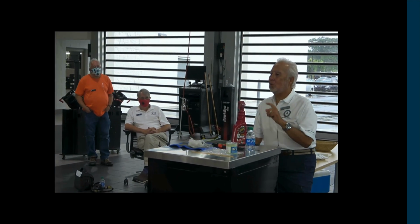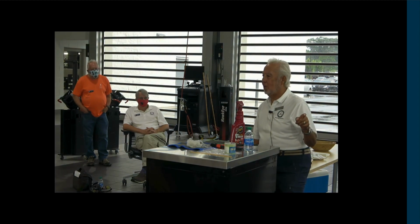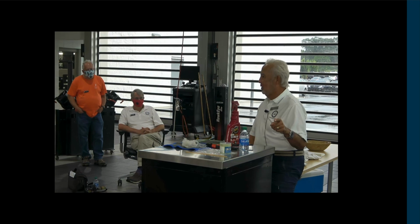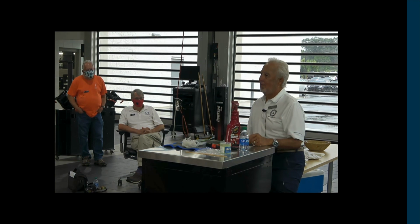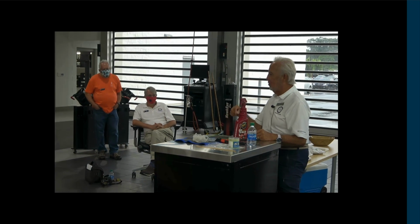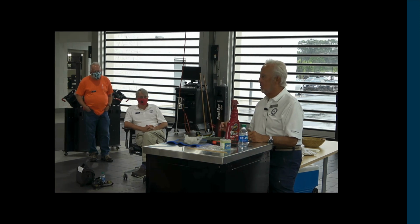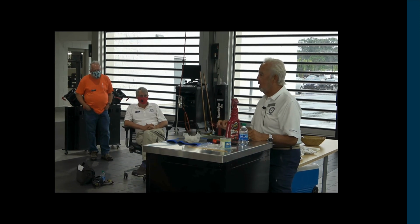One of the things you do want to watch out for, especially in some of the older engines like the 107s and 129s, is the coolant reservoir. Sometimes you get some overflow and a little discoloration in there, like a little green from the antifreeze that comes out. Get a small brush, get some cleaner, and clean that out, because you will get gigged for that.